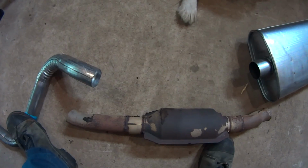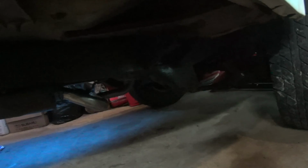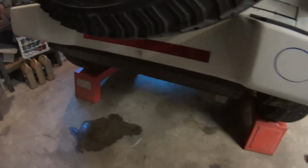Yeah. So the plan was bolt up the front pipe, see how much length we need on these pipes for the cat, and put these together. But they're the same size pipe. I have an exhaust expander, but it was purchased for my Camaro, which has much bigger exhaust pipe. So now we need to run to the store. We're just gonna buy some pipe to go over top of this pipe and maybe some extra clamps, and that'll make it all fit. Before going to the store, I got the front pipe bolted up loosely and just resting on the skid plate there. We're gonna hang the tailpipe up and then mount the muffler, and we'll get everything mocked up.